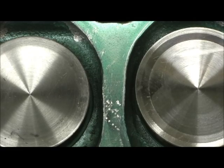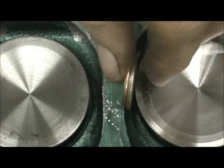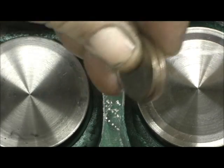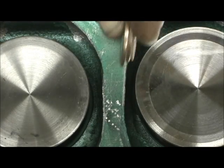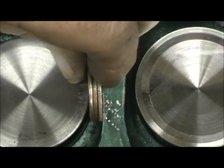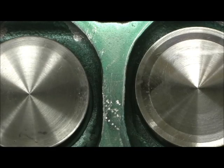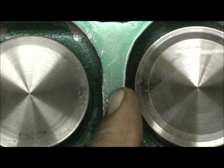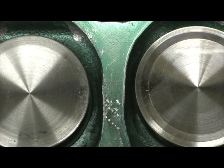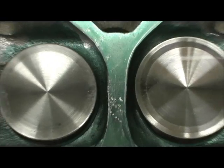As you can see, two quarters slide right in without a problem. Look at what two quarters does here with the 202 unshrouded versus the 194 needing three quarters. Now before with the 202, you couldn't even put one quarter in it — it was that thin — but now we've got that room right there, and although that might not look like a lot, it means a whole bunch in terms of airflow. If you ask me what trick per buck — if I had $150 — what porting modification would you want? I wouldn't even pick the ports. I'd say unshroud the combustion chamber to the gasket line so that it can let all of the air that's coming through the port, through the whole runner, empty and get in there. Because no matter how much you cut inside the port, if it can't do a good job of getting it around the valve and going into the bore, then it really doesn't matter.